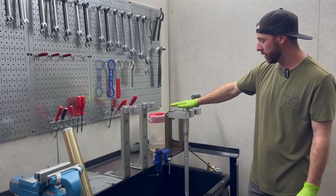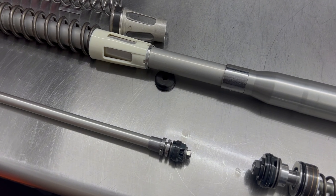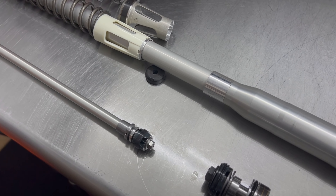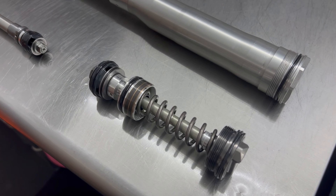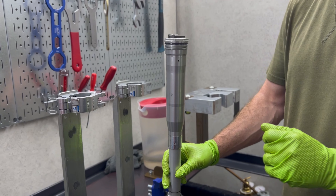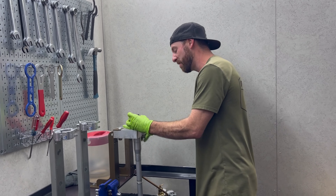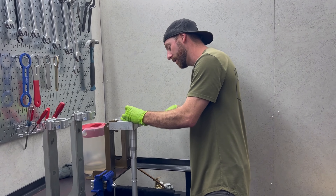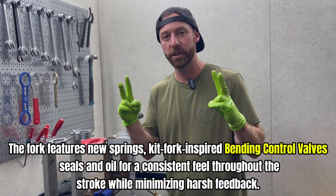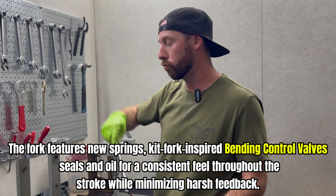We've got the new cartridge assembly here. At first glance it is very similar to what we previously had. What I'm looking at to quickly tell is all this tapering on this tube, and what that means is how our cartridge assembly vents off as it fills up with too much oil. This upper tank has the same geometry as the previous Hondas, so that is a good thing. Let's get this opened up now and see what type of valve we're going to find inside. What I'm really curious about is what Honda or Showa is referring to as a bending control valve — I think it's a leaf spring style in the mid valve section of the fork, but I could be wrong about that.